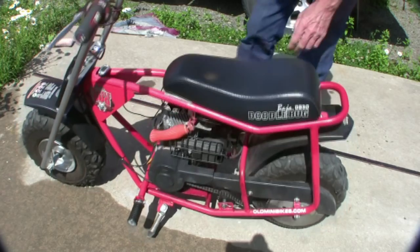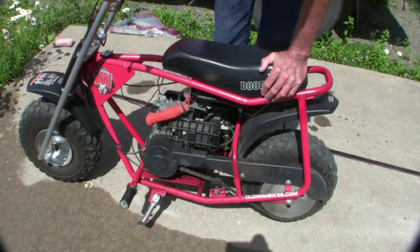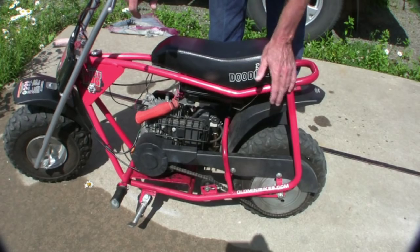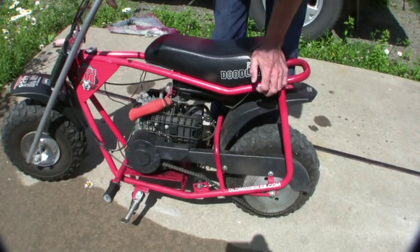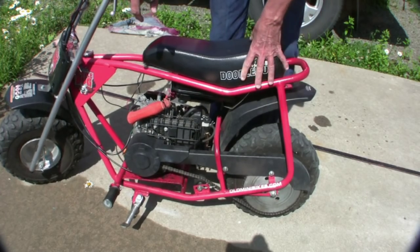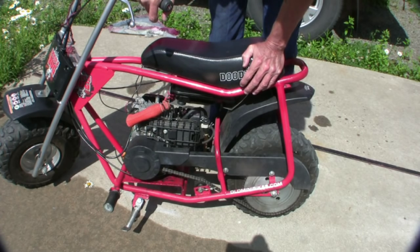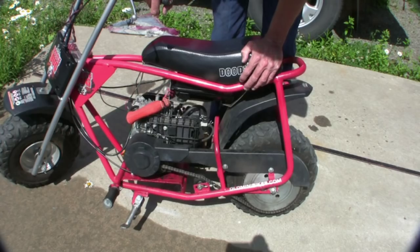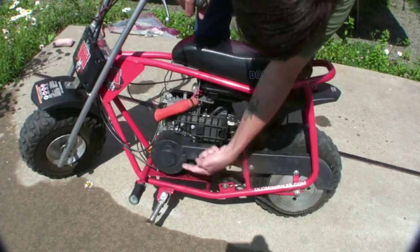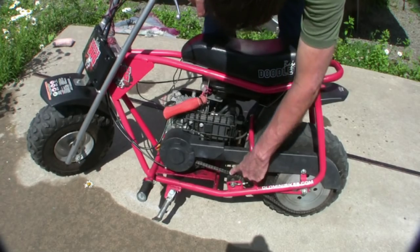That's what I would do — just get these, spend $300 for one of these. I bought mine brand new. Also this is the original chain and it has stretched about that much, so you want to get a link remover for the chain. It's not one of those pre-stretched racing chains like on a go-kart — it will stretch. But once it's pre-stretched this much, it's pre-stretched. Right now you can slide the engine forward and backward, and I had to slide the engine all the way backward just to get it on. See there, that's the master link.